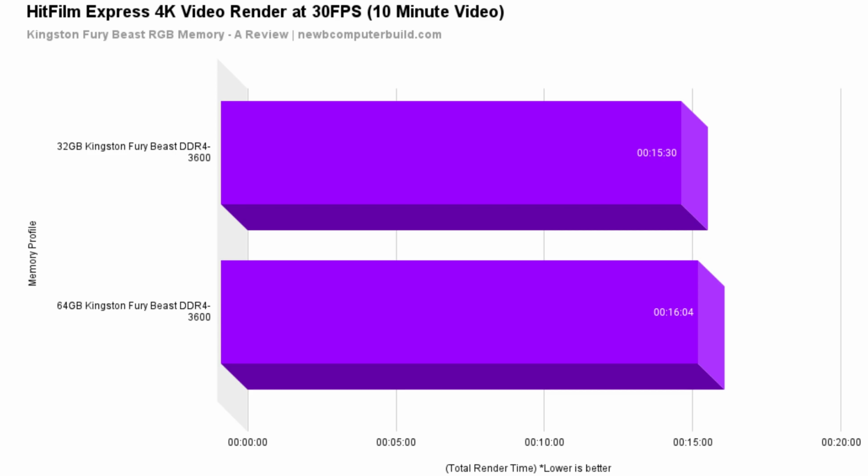I actually did a quick little video render test using 4K video, only 30 FPS mind you, for 10 minutes, and I used stock footage that went in a loop. I tested 64 gigabytes versus 32 gigabytes at our fastest speeds here, not our best performing speeds, at DDR4 3600 at CL16. What I found was there wasn't a difference. It actually capped out at 15 minutes 30 seconds for the 32 gigabyte kit, which actually won by roughly 34 seconds over the 64 gigabyte kit, which was 16 minutes and 4 seconds.